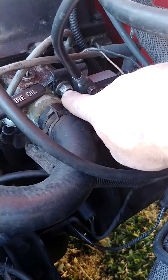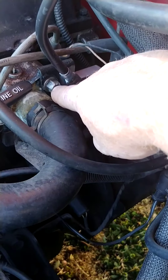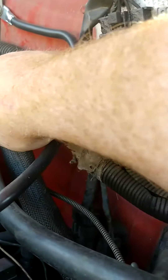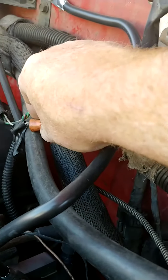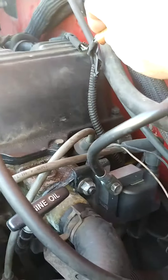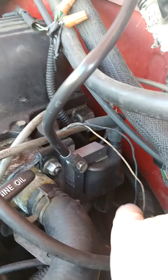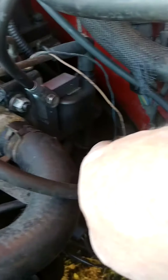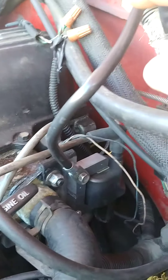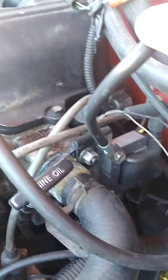The wire was going on to a stud that goes over by the thermostat housing, but that's all painted, so I wasn't sure I was getting a good ground. I put it straight to the coil. There was also a bad plug problem going to the bottom of the coil — I could actually touch the plug-in down there and it would stop working. So I went to the wrecking yard and got a pigtail out of a newer truck with heavier gauge wire and wired that in.